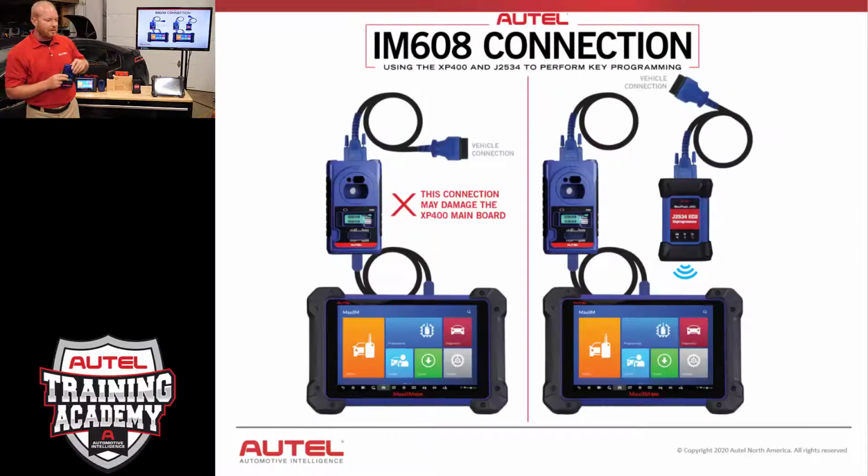Whenever we're looking at the setup of the connections, the J2534 device will connect to the vehicle with the OBD2 cable. As you can see here, this is the correct setup connecting to the J2534. You would never connect the XP400 or the XP400 Pro directly to the car. These boxes are made with magic smoke, and if you plug this box directly into the car with the OBD2 port, you will let that magic smoke out. Once you let the magic smoke out, you can't put it back in. So just be careful about how you're connecting it. Make sure you read your owner's manual if it's your first time using the tool, and that you are connecting it correctly to the vehicle.